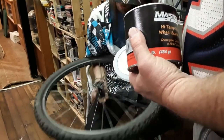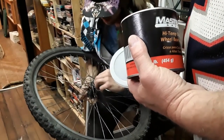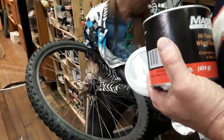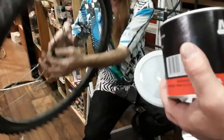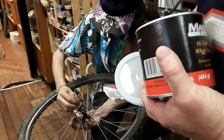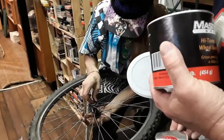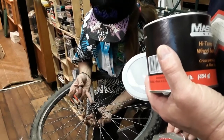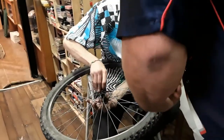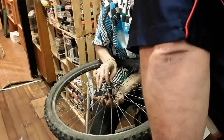What I was going to do, actually, is take them out, clean them up, the inside race. Yes. Because it needs to be done anyway, even if it had the cage. It's got the retainer, which is still on the axle for the other side. Got your hand on the back side so it'll catch it if anything drops? Yep. So retainer. How many we got here? 7, it looks like. 1, 2, 3, 8. Yeah, there would be 8 there. I figure it might be smart to count them that way. We don't get too many on one side of the bike.